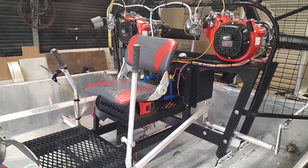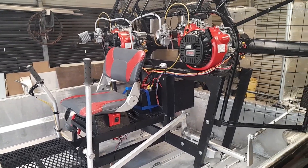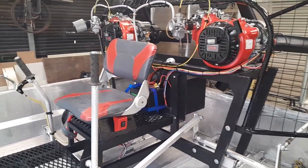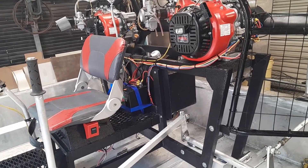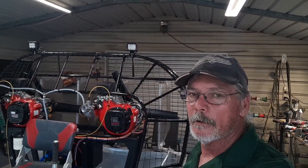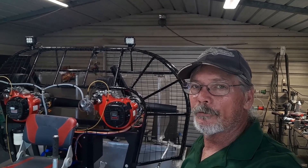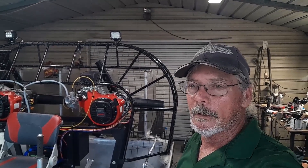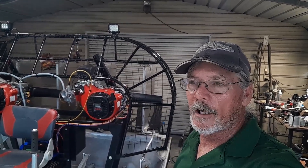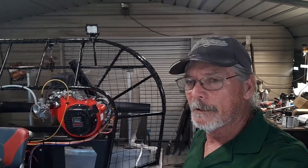Well anyhow guys, it's going to be the last video on this until I get all those things corrected. When I get them corrected I'm going to get some more video of this thing running. Hopefully I don't drop it off the trailer again, but we're going to make it work some kind of way. I'm sorry about the disappointment on this thing right now, but we're going to get it right. Also, these engines don't have a charging system, so I've got to order one — I think John Deere makes a 20-amp alternator. I'm going to have to make a bracket and put a pulley on the backside of that engine to make that work. Definitely got to have some kind of charging system, because with the fuel pumping and lights and everything it ain't going to run long.